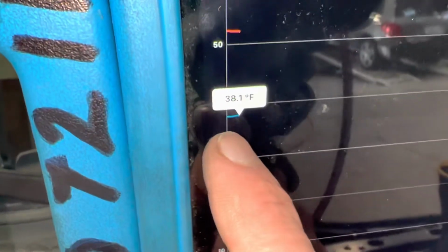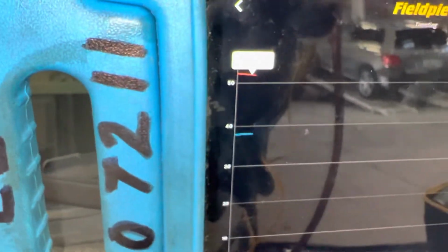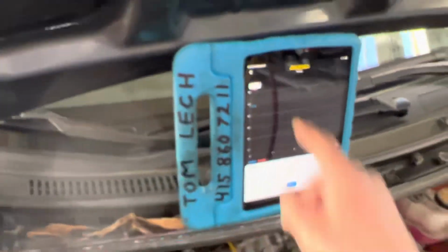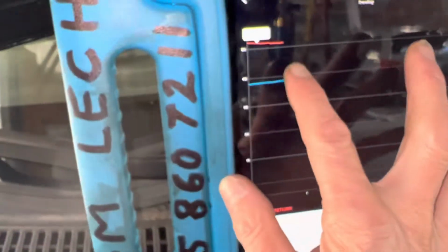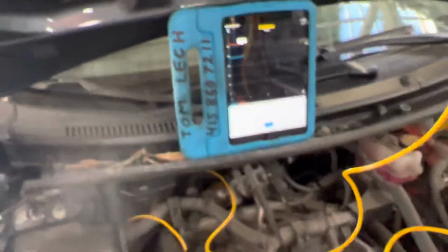Our temperature has actually gone back up to 38 degrees from 37. And inside the cabin compartment, it's 51 degrees in the recycled air. You can see the air is blowing up. I have them all pointing to the back of the cabin, and the air that flows back and comes to here to go back up to the inlet is 51 degrees. So we got a nice cool cabin. 38 degrees coming out, 51 degrees in the cabin.